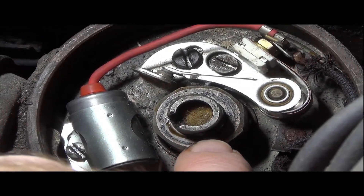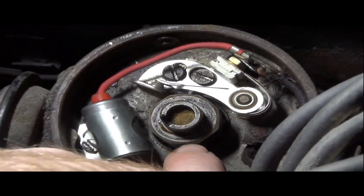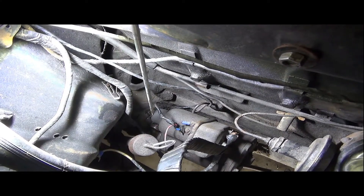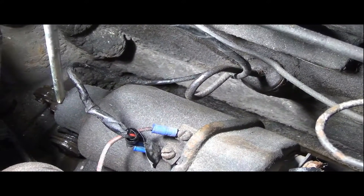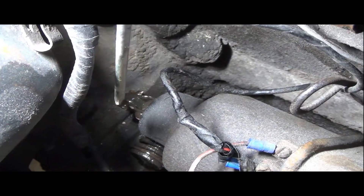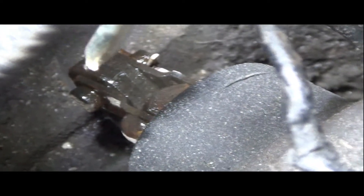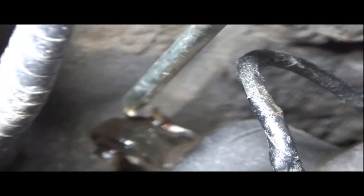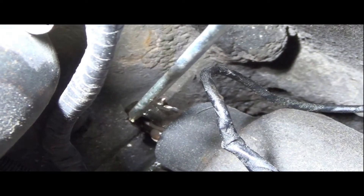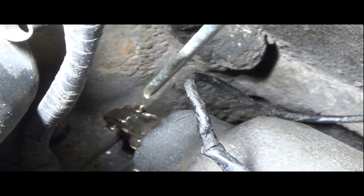Less is more with the oiling here. I'll clean everything up and use just a bare minimum of oil to get it done. Now I'm up top looking down on the cranking motor right there, and it's got a couple more lubrication points to go through. Kind of hard to get to, but right here — yeah, those are just some pins. You put a little oil on one, two — they're connected to the plunger that goes into the cranking motor.